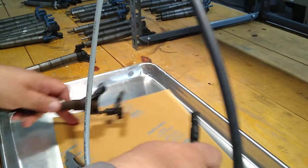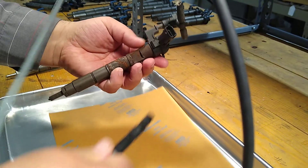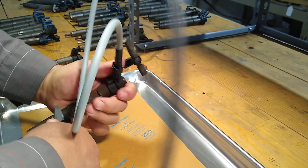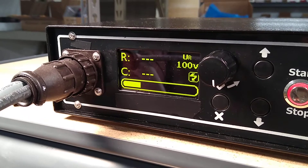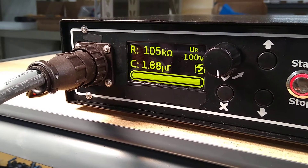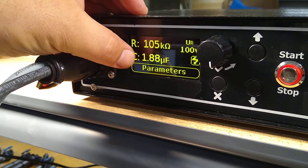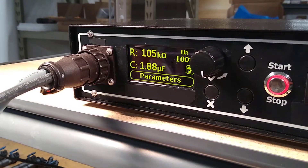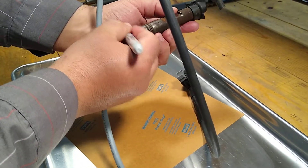Now, to contrast, we're going to grab, completely at random, a core injector. This one is in somewhat poor condition, but when we hook it up and hit start, our test box will have its little bar go slowly across the screen. The test box is displaying the voltage error signal, which means there's a problem with the injector. We find that the resistance on this injector is 105 kilohms and the capacitance is 1.88 microfarads. Capacitance is okay, but the resistance is low. We would not build up this injector — we would reject it and put a big old X on it for bad.